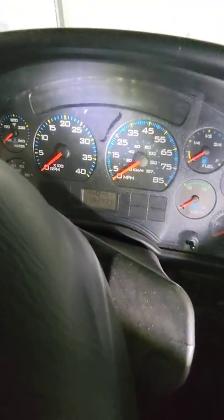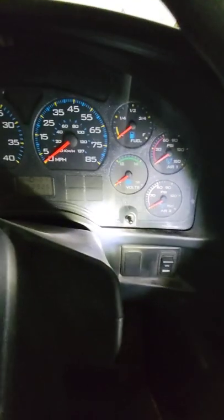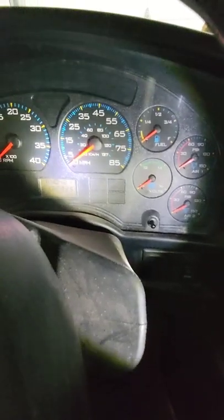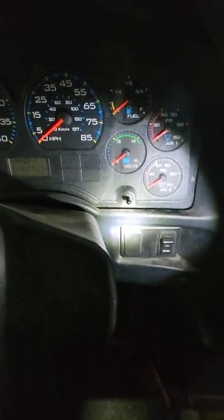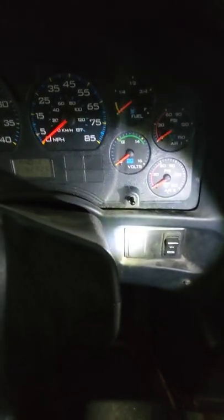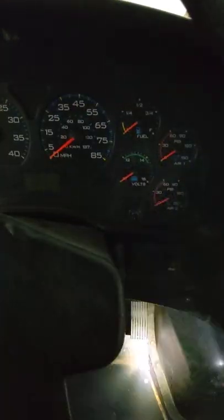When you turn the key on, we'll get the parking brake light — this bus has air brakes. We should get that orange wait-to-start light and you'll watch the battery meter. When the grid heater is running, it draws a lot of power, so your voltmeter on the dash will register very low. As soon as the grid heater is done, the wait-to-start light should go off and the voltmeter should rise above 12 volts. Make sure your batteries are well-charged — use a multimeter on the batteries themselves. You want at least 12.6 volts, ideally 12.8 or 13 or higher for good starting condition.